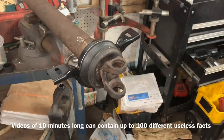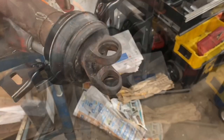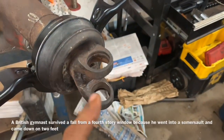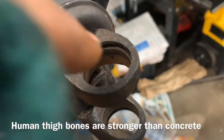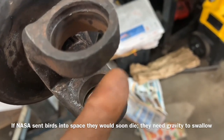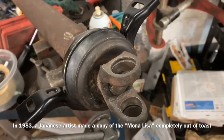We're just about ready to install our U-joints. We want to make sure we take a pick tool and clean out the rust ring in here on both edges and all four corners where we're going to install a U-joint. Then we want to take some emery cloth, sandpaper, or Scotch-Brite and work inside here making sure we take down all the rust. If we feel any dings from where we were taking out our U-joints, we need to get a file and file them down so the U-joint will go all the way through like it's supposed to.